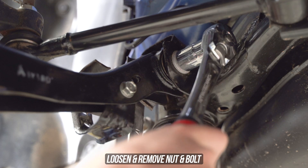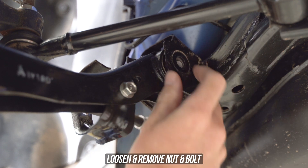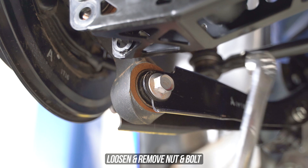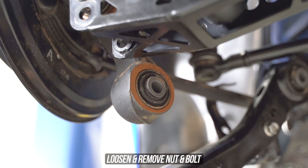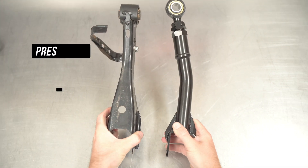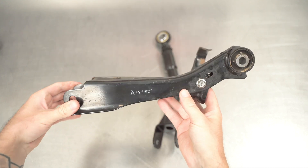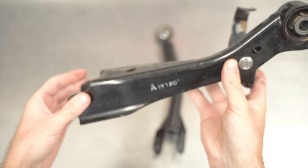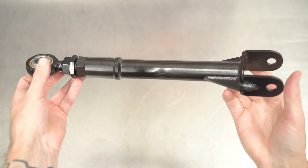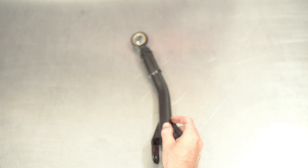Sling your spanner and ratchet up and wind off the nut securing the arm to the subframe, then punch that bolt out of the way. Head to the other side of the arm, sling your tool up, wind that nut off, punch the bolt out of the knuckle, and proceed to remove the arm. For a visual comparison: on the left you have the press-bent, thin, conservative traction arm fitted with a rubber bushing. On the other side, you have Ultra Beefcake 9000 — a fully adjustable chromoly GK Tech arm that will more than likely outlast the longevity of the car, and can also double as a battle weapon for the alien invasion that's coming soon.